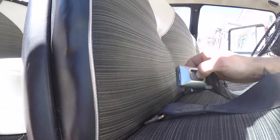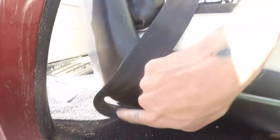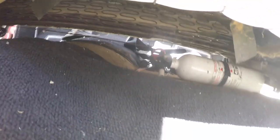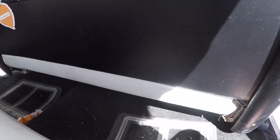Alright, so we're back with our belts. We need to figure out where to mount these guys. I think I'm going to pull this bolt out, drop this down to here, and have it come up and through the seat between here — so that'll stay like that. The other one, unfortunately, there's no mounting points in the middle, so I'm going to have to figure out some way to mount them probably to the seat itself. The back seat — same way — just run them under here to some kind of mount underneath. There's got to be some bolts under there, and then we'll have seat belts.